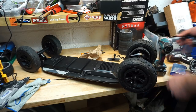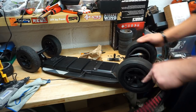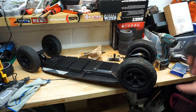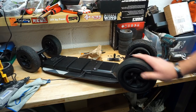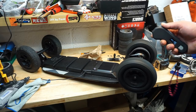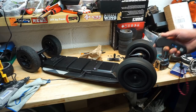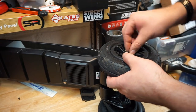Please make sure you pay attention after you put everything together. Just take a look — making sure everything is nice and where it's supposed to be, nothing is catching. Look at everything one more time. The belts are nicely sitting on the pulleys, no issues, nothing is loose. Then run the board on the desk as well. Don't go 100% speed when the board is not loaded — meaning there is no person on top — it's not good for your speed controller. Go reasonable speed but not fully maxed out, just to ensure the belts don't come off.